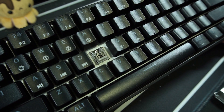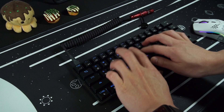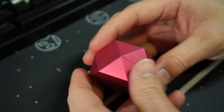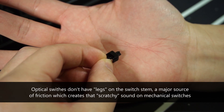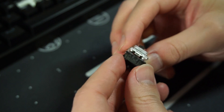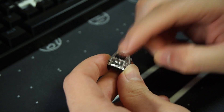The switches on this keyboard are Gateron Optical Blacks. They have a 60 gram actuation force, which is 15 grams heavier than what a lot of you might be used to — the Gateron Reds or Cherry MX Reds actuate at 45 grams. I opted for the heavier springs as I'm pretty heavy-fingered and would mistype all the time on lighter switches. Optical switches are much smoother stock compared to mechanical switches, and these are no exception. They felt nice to use, and I actually found myself pressing the keys down constantly because they were just that smooth. Aside from the ping you get from the un-lubed springs — which can be fixed by taking these switches apart and lubing the springs with something like Krytox GPL 105 or 106 — I really enjoyed using these optical switches.